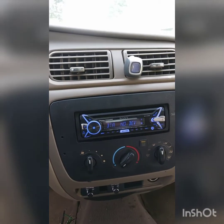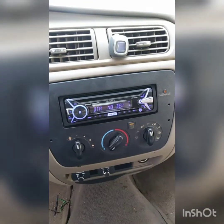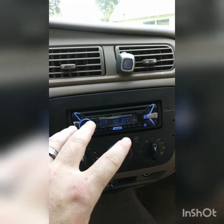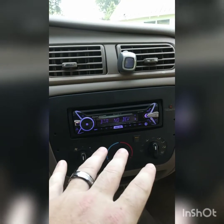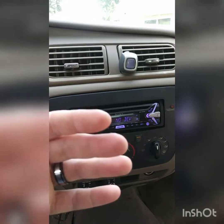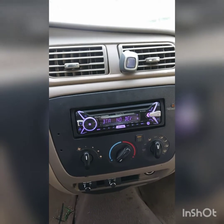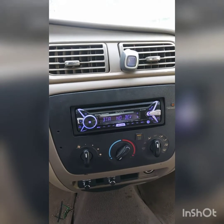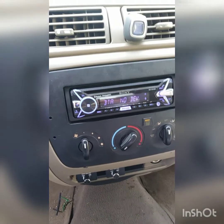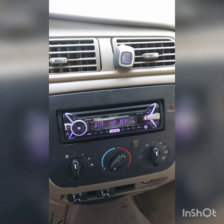It's always a good idea to unhook your speakers to prevent damage to them. For the purposes of this video I'm not going to pull the head unit out and show how to set the head unit to clipping — I'll just show you at the amp because it's easier to access the terminals there. You always want to start at the head unit and work your way back. The first thing you want to do when setting your gains is start here at the head unit, which is going to be the source of the signal for the rest of the equipment.